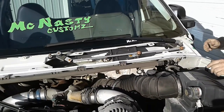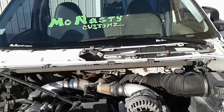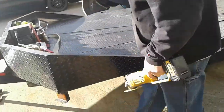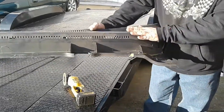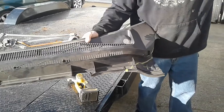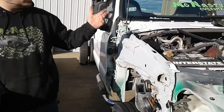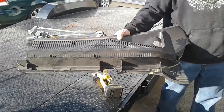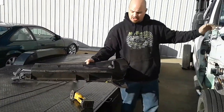So that's the basic install for this. Now we're going to show you how to do the plastic cowl covers. This is your plastic cover — this is the left-hand side cowl cover for the newer 11-16 nose. On the 08-10 nose, you can use the 08-10 cover and pretty much bolt it onto the truck. You might have to drill a couple of holes, but you use the 08-10 linkage and the 08-10 covers and they go right on the truck.